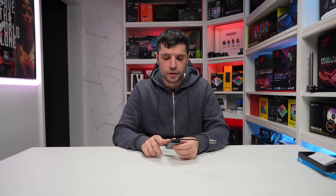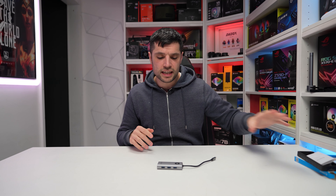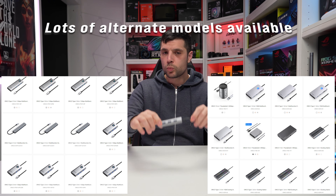On this side we have a 100-watt charging port, which is fantastic if you've got a tablet or laptop that's only got one charging point and you've got multiple other connections — maybe you want to get your mobile phone plugged in and don't have all day; this would charge those really quickly. We've got a 4K HDMI port here, though it's limited to 4K 30fps, so don't think you're going to get 60fps from this. We've also got a USB Type-C port at five gigabits per second, and on the other end three Type-A USB ports also at five gigabits per second.